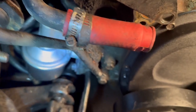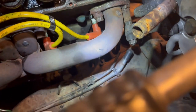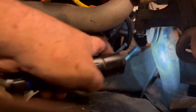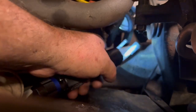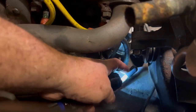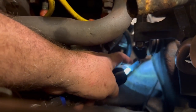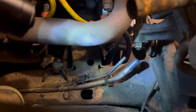I'm not going to give you the torque — you have to look that up. I just tightened mine up, nice and tight. One more thing about the fuel pump: when you disconnect the original fuel pump, the larger line is your feed line or inlet. When you unhook this line, gas is just going to pour out of it — it's going to gravity feed. I've got a rubber cap that you might use to plug a vacuum leak over the top of it. When I get ready to hook this hose up, I'll already have the clamp on the hose and be ready to catch some gas because it's definitely going to flow out.